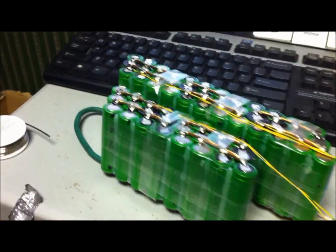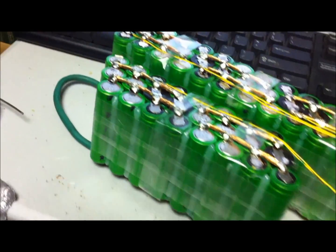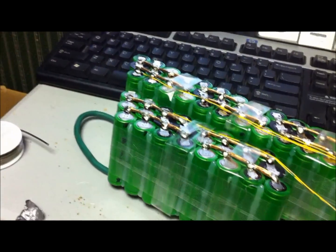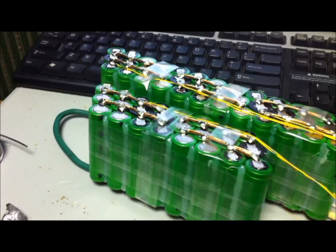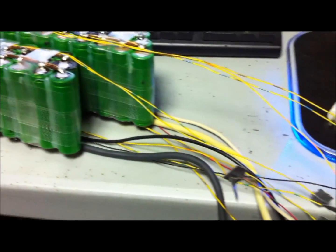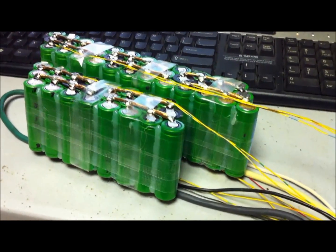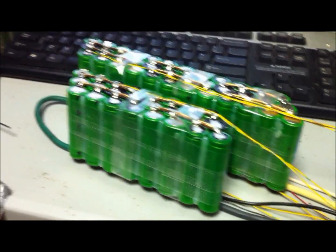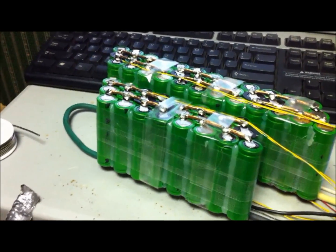This half of the battery's done. I've got all the balance leads, and I've got that high tensile tape just going around it so when I heat shrink everything, everything stays in nice and I have no problems. The first battery pack came out great, so I expect the same on this one. It's fully wired and ready to go. Get it in the bike tomorrow, hook it up, get a test ride, and see how these cells actually perform.